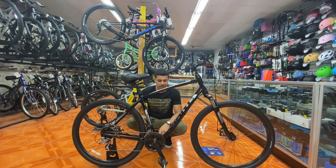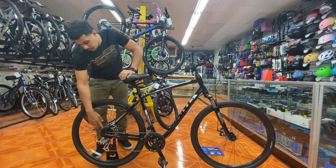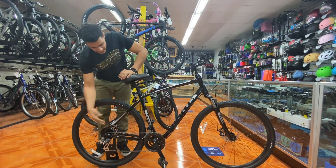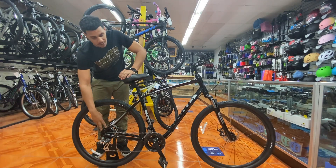On the front, you get a 28 to 44 chainring range, which is a really big jump. The 28 being the smallest ring up front makes it easy to pedal so you can get over any obstacle, while the 44 is the bigger, harder ring for when you want to go really fast. On the back, you have an 11-34 spread — an 8-speed with 8 different cogs. You have a wide range: put it on the 11 for speed, or drop it down to the 34 for climbing or maintaining speed on hills.